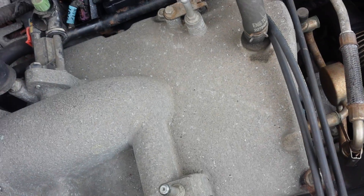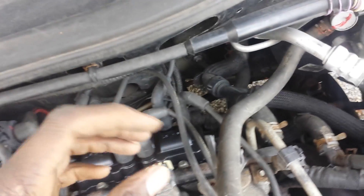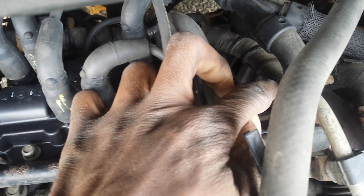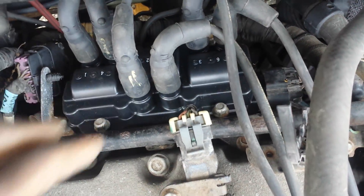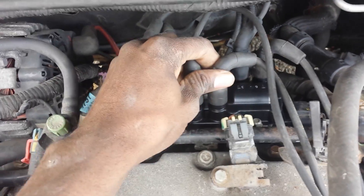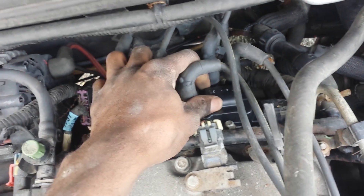The quick way of doing it is to disconnect the four 10-millimeter screws and disconnect the plug, which is right here. There's a pin that you pop back to take it off — disconnect it, get the new one.